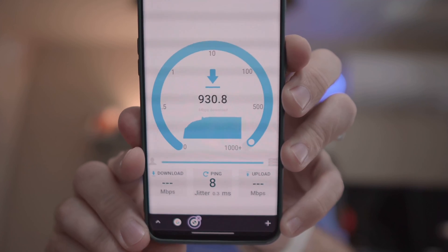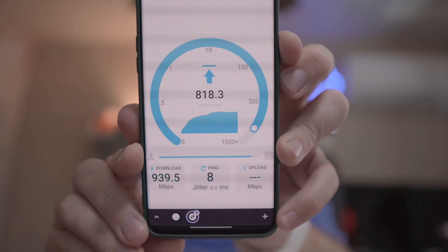I'm still using the PoE injector and I'm curious how this will perform if I connect it to a 5 gigabit PoE switch. Now I'm using a 5 gigabit PoE switch — let's run this again on 5 gigahertz. Definitely a lot faster, so I suspect the PoE injector was the culprit. That got 939.5 megabits down and 825.2 megabits up over 5 gigahertz using 80 megahertz channel width. I'm also curious if there is a model that allows 160 megahertz channel width on 5 gigahertz.